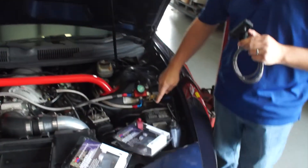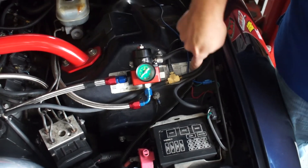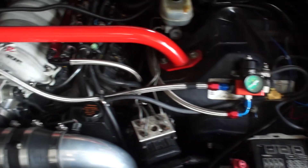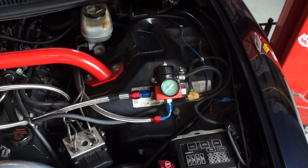We've done it here in our Trans Am. We've got it going in line with our fuel pressure regulator. So we come off a common vacuum source through a T back through our intake manifold, and therefore whatever the pressure is there, it's going to go ahead and read through the sensor here as well.